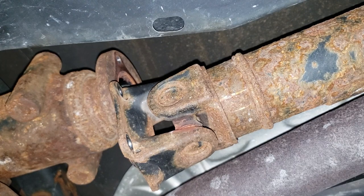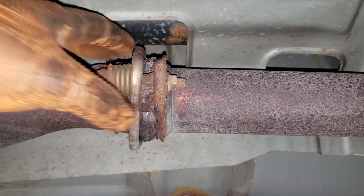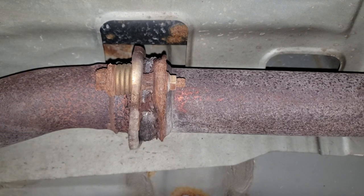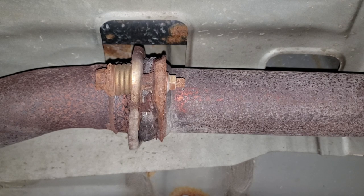That guy separated — let it rest on your exhaust. Now what we're looking at is a potential for issues that tissues just won't solve. Whenever doing a drive shaft, most times it is recommended that you move the exhaust, except we're not in Florida or California and our exhaust looks like this — the flange and the spring and bolt look pretty rusty. It looks like complete dog shit and if we try to take that apart it's going to smear rust particles everywhere, so don't touch it whatever you do. Most times I can slip the shaft out through the back over the exhaust without putting a hole in it — it saves you time and money. Our next step is to get the shield off which is held on by four 12 mils. The rust is a problem so get an impact gun and pray to god they come out and they don't break.